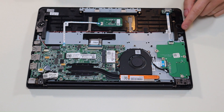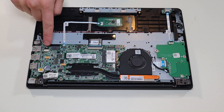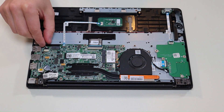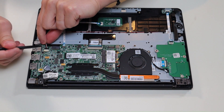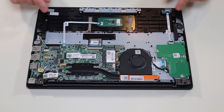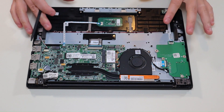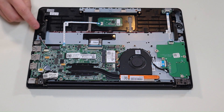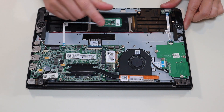Your speakers are right here — you have two speakers. This one is set in there, the wires go across here all the way to this speaker, and this speaker plugs into the motherboard here. That's just like the battery plug: while you don't want to pull on the wires in most cases, there's no real grip there, so you do kind of have to pull on the wires a little bit. You can use a small flat plastic pry tool to jimmy that out as you're pulling on the wires. If you're replacing your speakers, make sure that when you put them back these wires follow this path so that they don't get crimped by the battery and break. The speakers are not screwed down — they're just held in by rubber washers so you can wiggle those off. I'll try to have replacement speakers in that parts link.